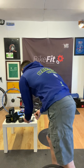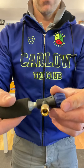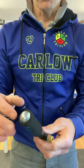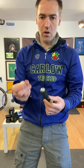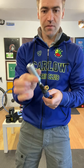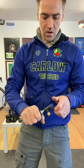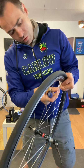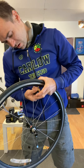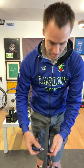So there are the options. This one may have gas in it or may not. For this particular one, it screws in onto the valve. Then we're going to open the tap. As the gas comes out, the cylinder gets very very cold, so it'll burn your hands - that's why it has the cover on it. Always make sure to have the cover on; don't hold the cylinder itself as it's inflating the tire or you'll get frost burn. Hold the cover and use the valve. This one had already been used for one repair, so I don't know if there's anything left in it - we'll try it. Put it on nice and tight, and just open that valve.